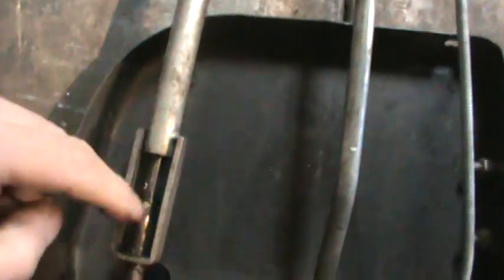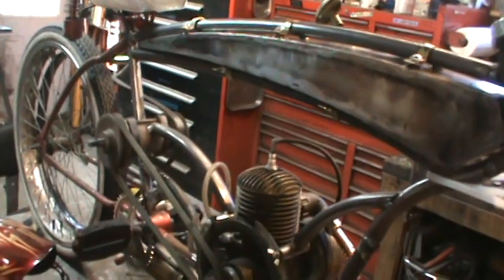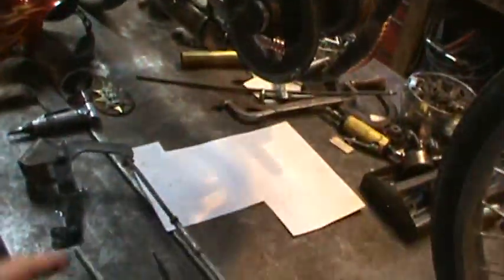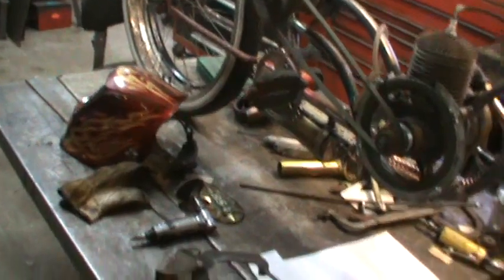This one, it's got a spring up in the rod and then a set. So it's got a little bit of a preload to it. If I use this setup, you could use it as a cushion on the belt, where you maintain tension. Any irregularities in the belt of it getting tight and loose, you could absorb by having that in there, so the tension pulley can bounce around a little bit.